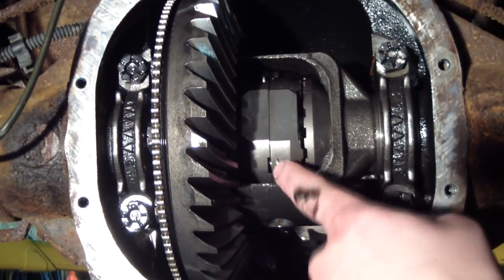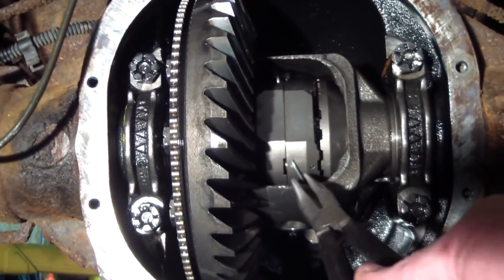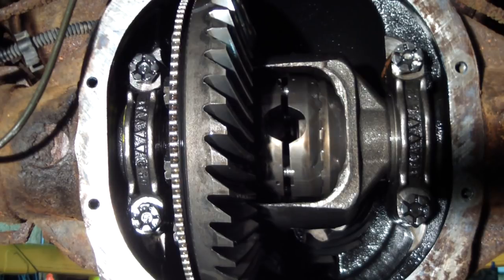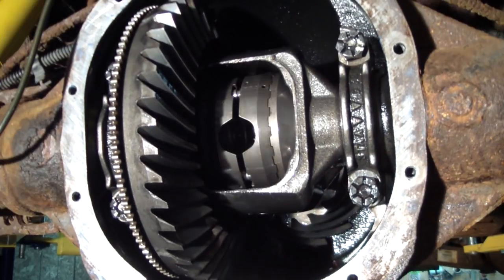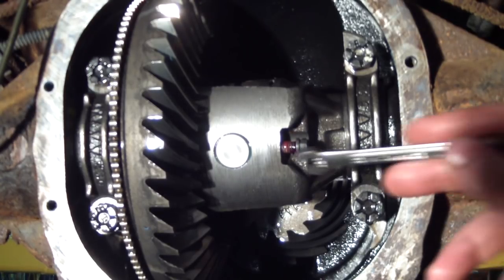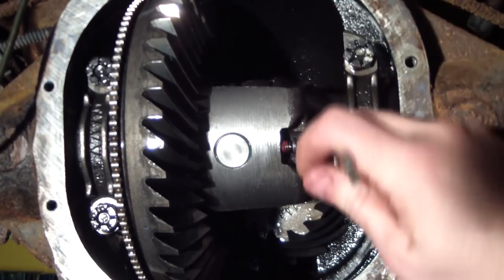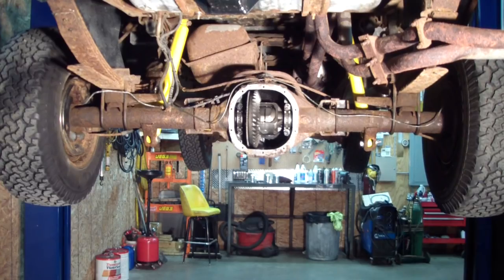I've got the whole works lined up so it's aligned with the cross pin shaft and the two center drivers are in alignment with each other. I'm pulling out the retaining pins. The instructions say this distance is supposed to be between 145 and 170 — I'm right there. I'm lining this up with the cross pin bore on the carrier and installing the cross pin shaft. The carrier was cleaned, installed with green Loctite using a turning action. I have a little bit of red Loctite on the retaining bolt and I'm going to send that home, then let this truck sit for 24 hours while the green Loctite cures before filling it with gear lube.